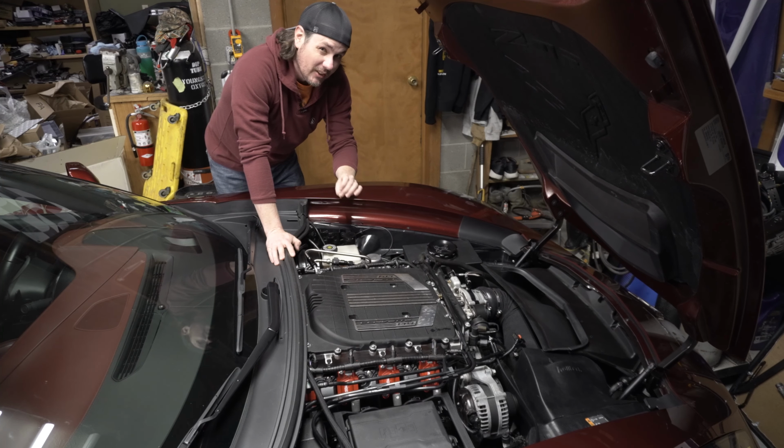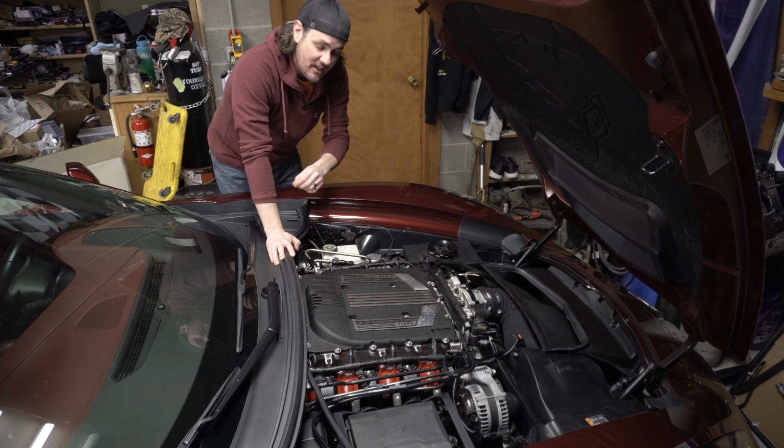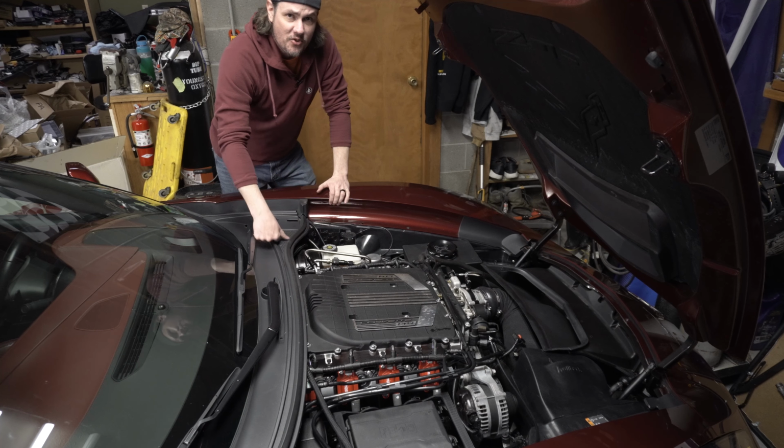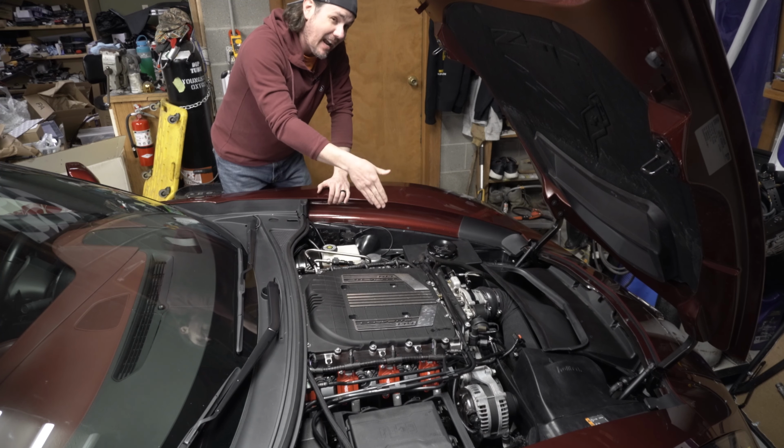Remember, you're going into aluminum. You don't want to start a bolt sideways on these heads, and double check the torque for the heads on these things because it's really low. It's real easy to strip out header bolts on these things. Then you're going to be helicoiling and it's going to be a pain to get in there and do it on this platform.